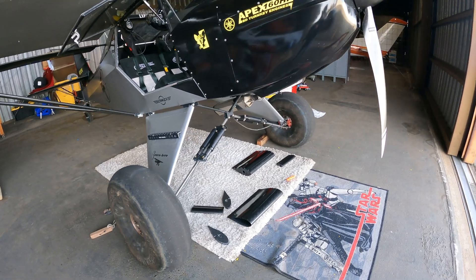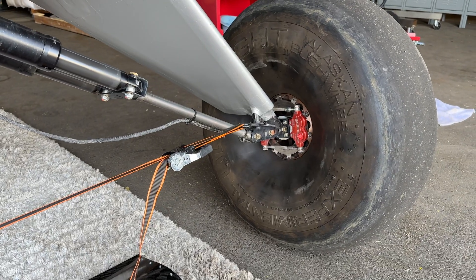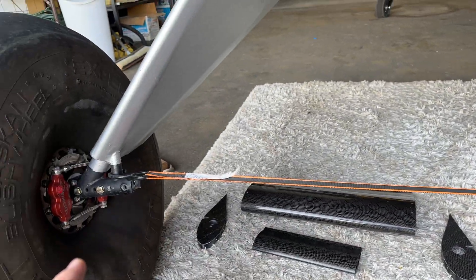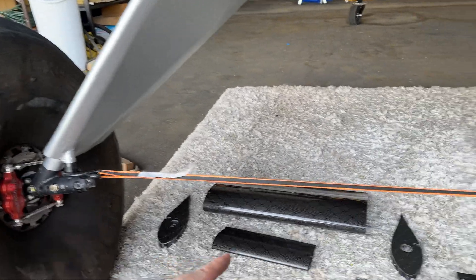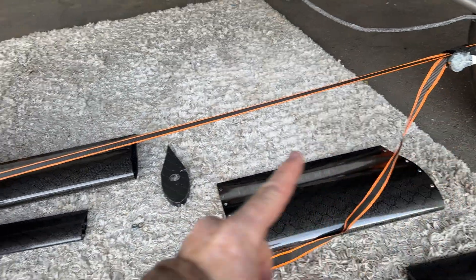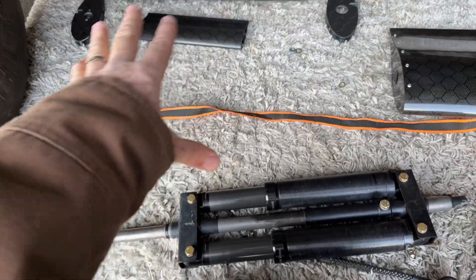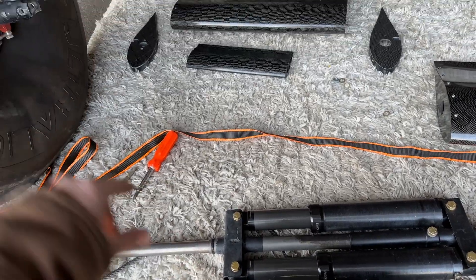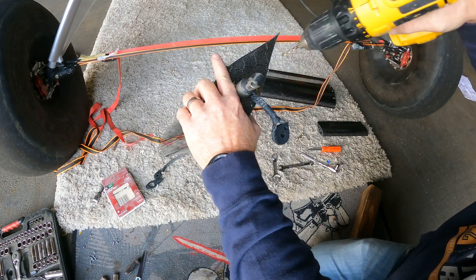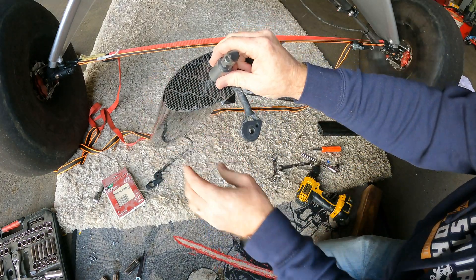It matches the carbon fiber wing strut fairing — you can see the honeycomb on that as well — so it's going to be a really clean look when it's all done, everything's going to match, and we should pick up some speed. One way to do this without jacking the whole plane up is to put a tie strap between the two, keep lifting the wing up as you tighten it down, and it will eventually take the load off the shock. Then you remove it and the plane is held by the strap, keeping that gear from sliding out. Now I've got the shock off — time to play around with installing the fairing and then get it back on and do the other side.